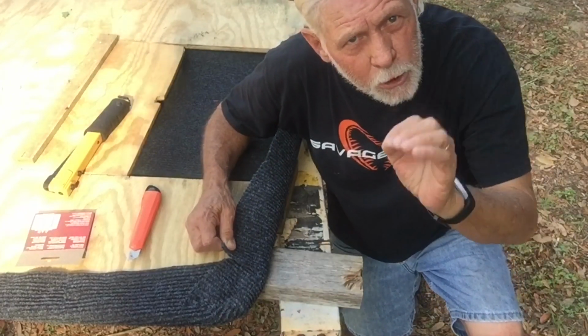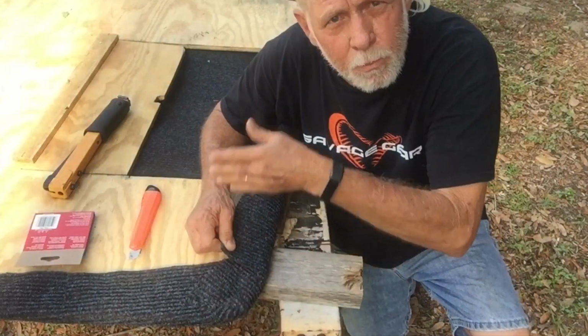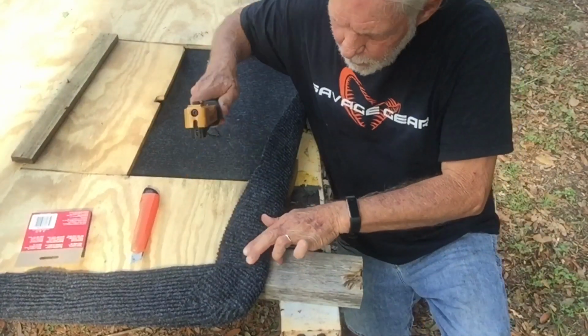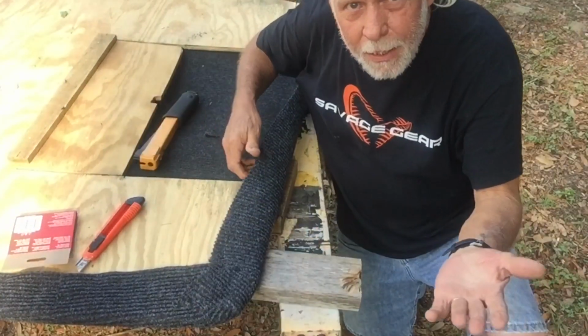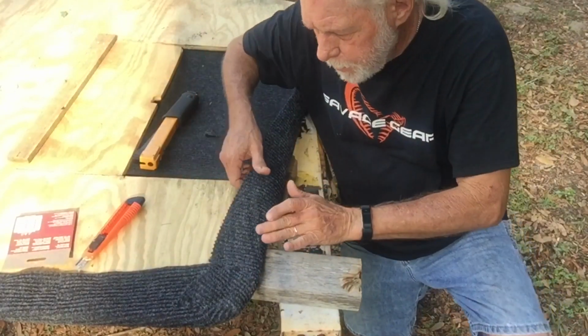That's important because when you put it back in the boat, it has to have pretty much that same diameter, that same width across. So you want to pull that up, and then take that hammer tacker again and just tack that down. Simple as that, guys. Then with the rest of it, as you see, this thing comes at more of an angle this way, so it's not straight, it comes back at an angle.